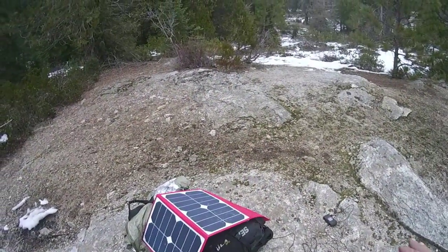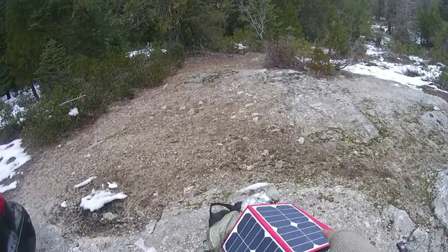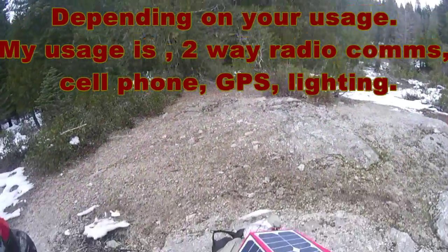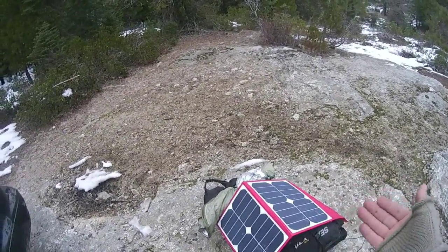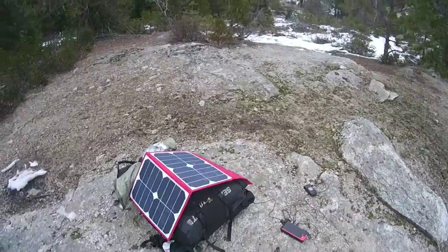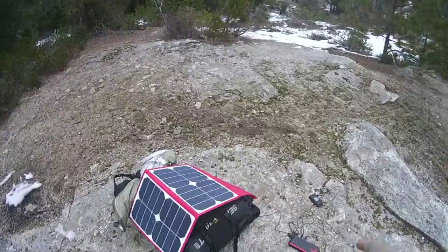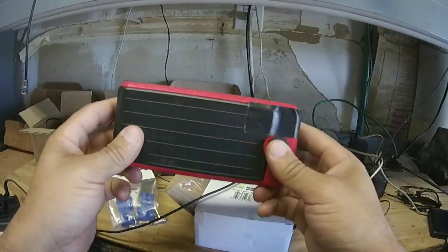This is all just to prove a concept, not to prove specific gear. In some areas like the desert you might get away with 15 watts of solar panel, but in the Pacific Northwest or northeastern states where you get winters with hardly any sun, you may need to bump up the wattage to produce the same power that a 15-watt panel produces in a desert with constant sun. You play around with those numbers to reach your end goal. I like to go overboard a little to charge equipment as fast as I can.